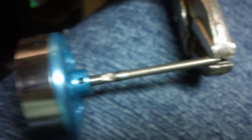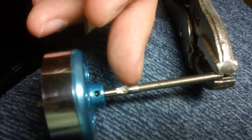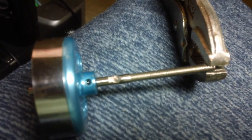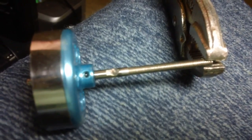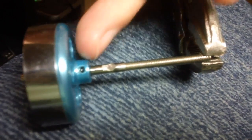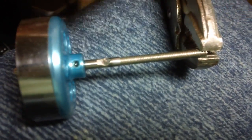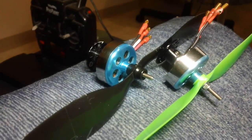Once you get to that point, slide the bell and jiggle it back up into its original spot. Leave the grub screw out until you get it all back together again. Make sure your bell is fitting right and not binding, then take some blue Loctite — the stuff you can remove — line it all up, put some Loctite on your thread, and tighten it back together.